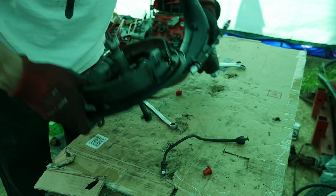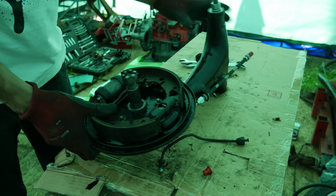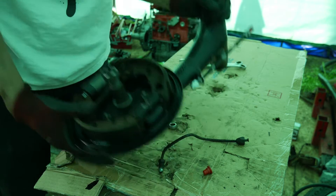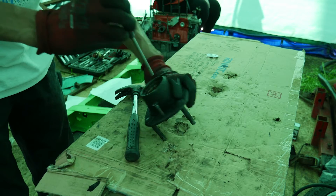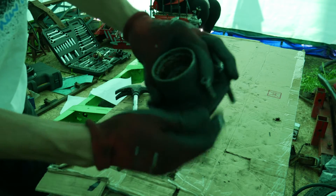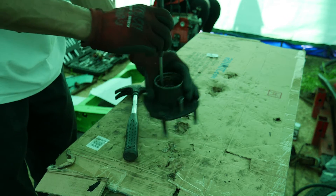We'll flip it up this way and now I'll show you how to rebuild the wheel bearing, then we'll proceed to fit it as one piece. Here's the hub unit — the races are left in there. It's hard to see but in here you'll find there are two machined notches on each side which will help you knock the old races out.